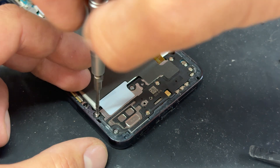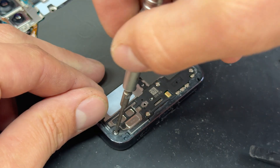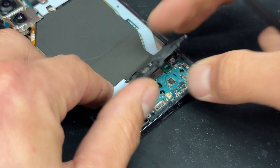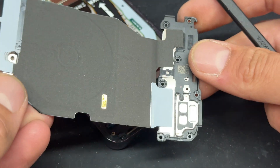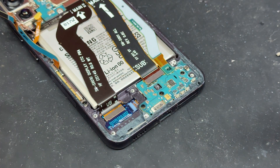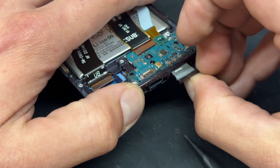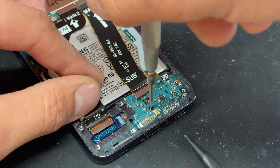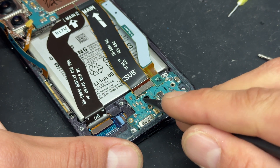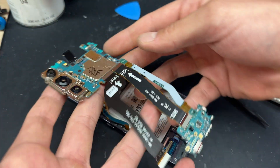There are nine more crosshead screws holding this in place. Go ahead and remove all nine of them, releasing the loudspeaker at the bottom and the subboard. With all those screws out of the way, use a plastic spudger to lift up the plastic cover. The wireless coil and speaker came off together because it's stuck to it — I prefer to just leave it all stuck together. Disconnect the flex cable at the bottom, remove the SIM tray, and remove the three black screws that hold the subboard in place. Lift up the subboard, prying underneath and sliding it out from the bottom. That allows us to remove the whole logic board still attached to the cables, ready to transfer into our new chassis.